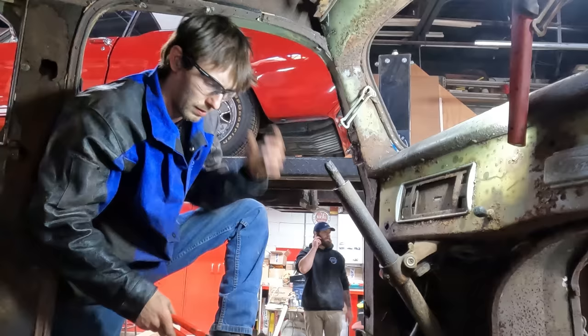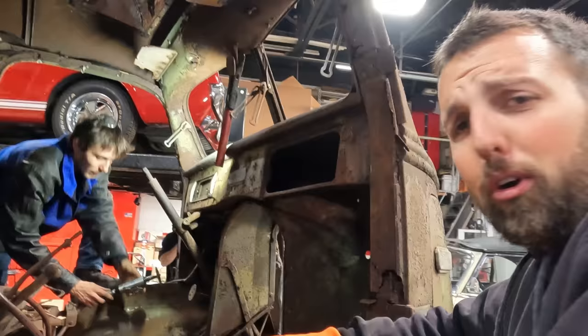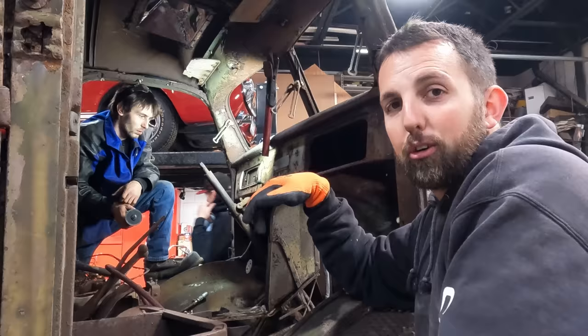When I was out in Iowa, as soon as I pulled on the steering wheel, it broke off. So we cut the outer part of the column to expose the shaft so that we can get vice grips, channel locks, maybe clean up the splines on that and get our steering wheel on it. But that sheath on there, they were both flush and there's nothing we can do. So if we get it steering now, we can actually steer it, whether we tack weld a steering wheel on it or whatever. That column's all froze up nasty anyways.